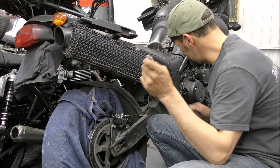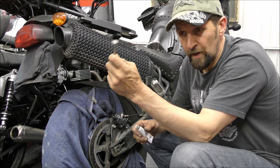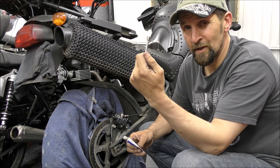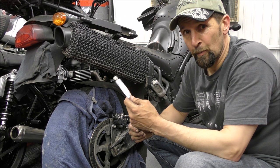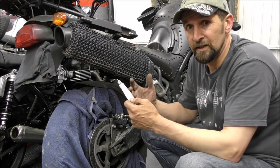and some copper slip. And somebody asked the other day, these are brakes and brakes are important, why don't you put thread lock on there instead of copper slip? Copper slip means they'll fall out. Well, I hope this video has answered that. They really, really, really don't fall out. In fact, that's the point with these brakes. Any fastener around this area is going to actually seize in there.